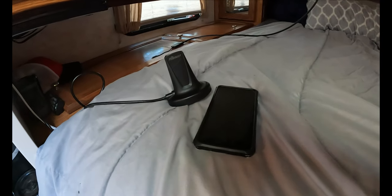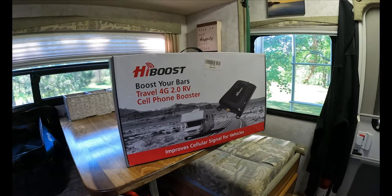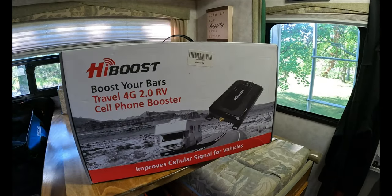It's been a few months since I've had the High Boost installed. We've been up to the border of Canada, all over northern Minnesota, and it works — it does what it says it's going to do. A couple of things I've noticed though: you have to have the cell phone really close to the antenna. If there is no cell service available it's not going to boost anything because it has nothing to boost. One catch I found: if I have really good service and put the cell phone next to the antenna, it'll actually drop the speed down — like from 40 megs down to 25. But when I have poor service, like one or two megs upload, putting the cell phone next to the antenna has boosted that up to 10 megs, which is a usable signal.